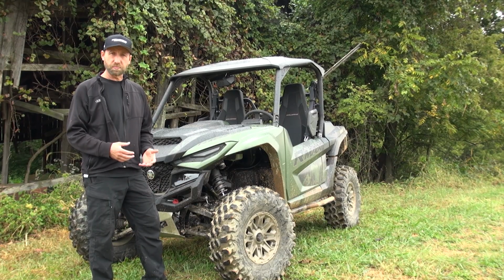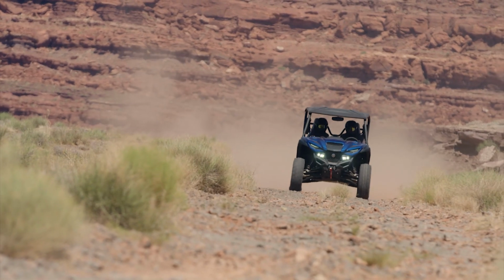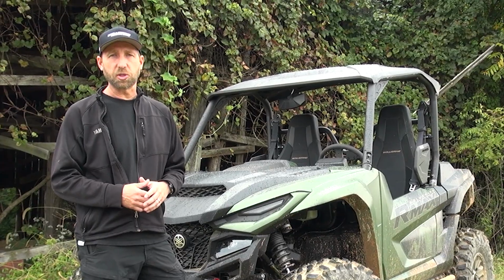Once we bump it up, again, probably more on the West Coast, with the higher speeds and bigger bumps, we like to go to position number 3, add a little preload potentially, and then up your tire pressure. Again, works really well on the West Coast especially.